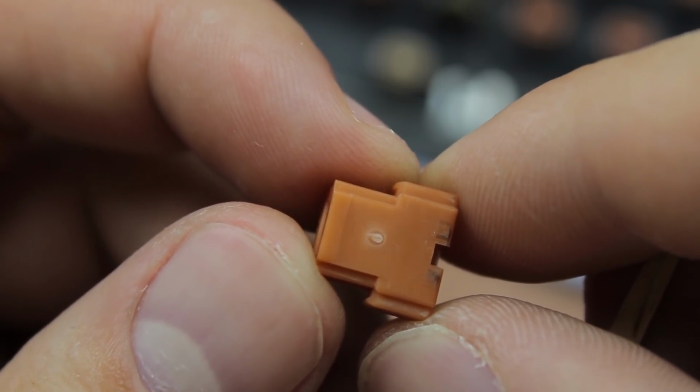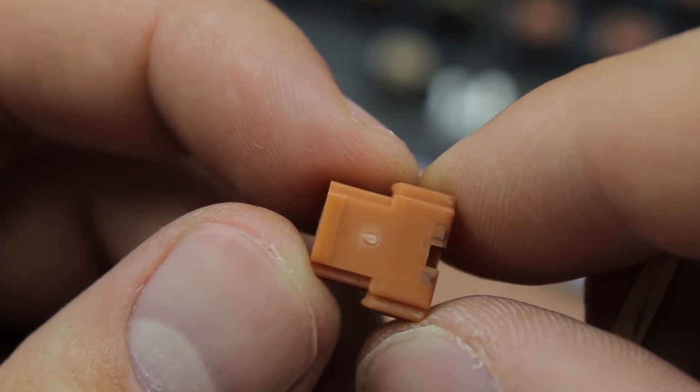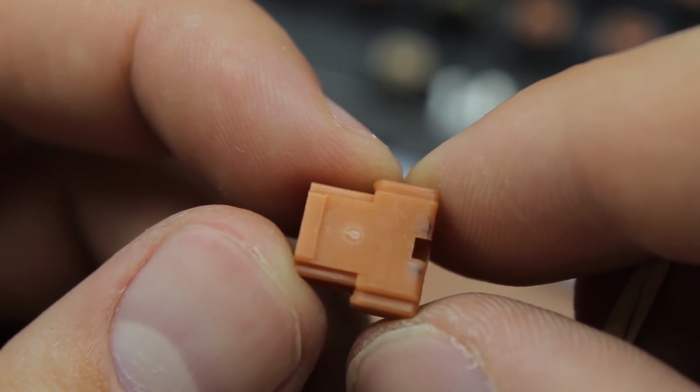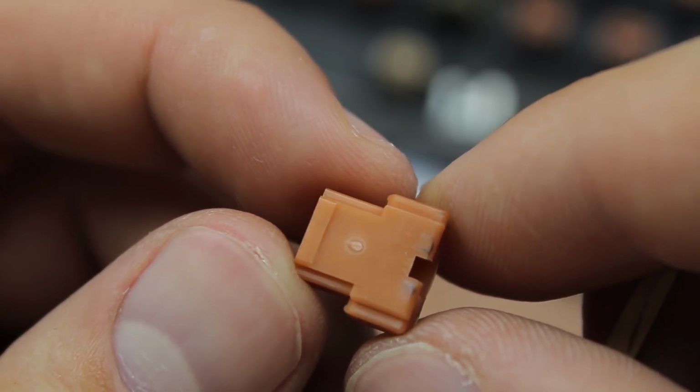Secondary ones are the friction between the actuator and the slider. If your switches have pre-applied lubricant, such as these oranges, you can usually see bits of it missing where the actuator scraped along it, and sometimes dark deposits like this.